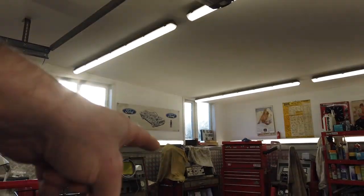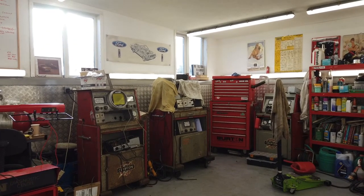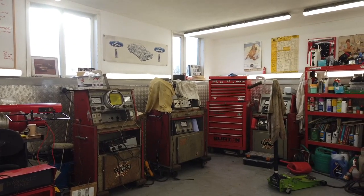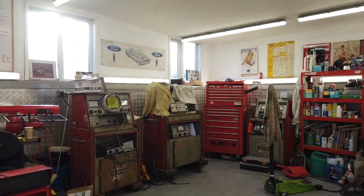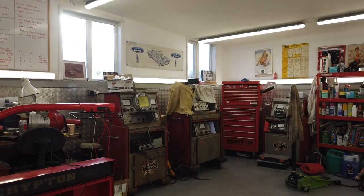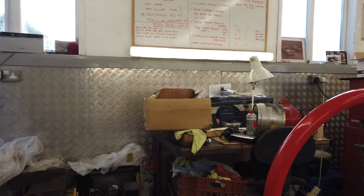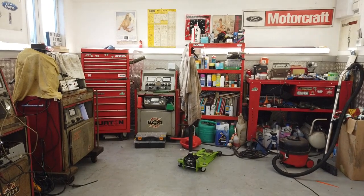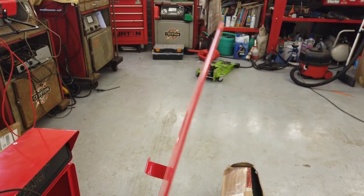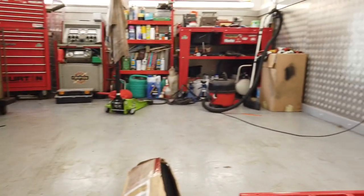We're going to dip that. We're not going to shot blast it. We're going to dip it. Reason? The gentle shot blasting guys that I've got with the low power shot blaster, it won't fit in his cabinet. The industrial guys I used for this, I did notice it's quite aggressive. Although it hasn't rippled any of this casing, it did put a curve into this plate, and that's quite thick metal. You can just see it coming down now.